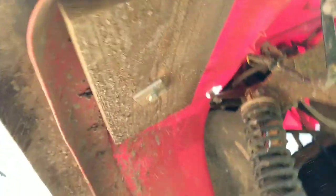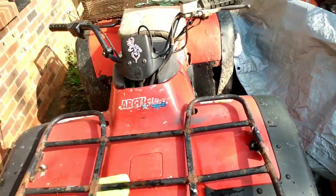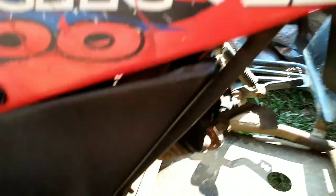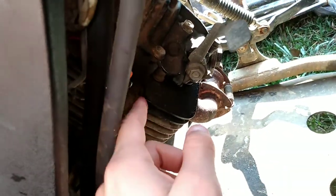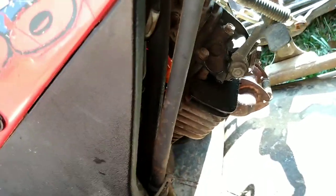As you can tell, just to keep it from rattling I've got wood under here. As far as what's wrong with this — we have fixed some parts on it before. At first it was misfiring. First thing I did was pull that spark plug right here, put on another one, and it was still missing — not as bad, but still missing.